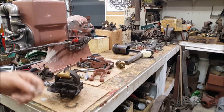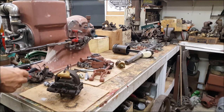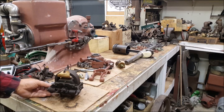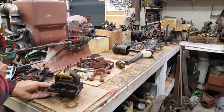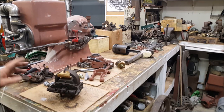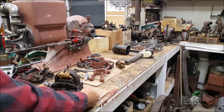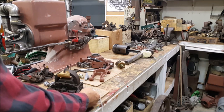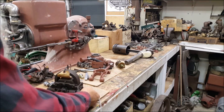The point is, it's got a little probe on this wire right here, and it checks the gauss that's in your magneto. So, down here at the bottom of that horseshoe magnet, you put this little probe in close vicinity, okay, I'm actually touching it, and the reading is 14. I'm gonna say 1420 when it evened out. So we're gonna check the other side, and this has got a minus up there. The reading on this side is minus, putting it in the same position as on the other side, and I'm getting a minus 10.